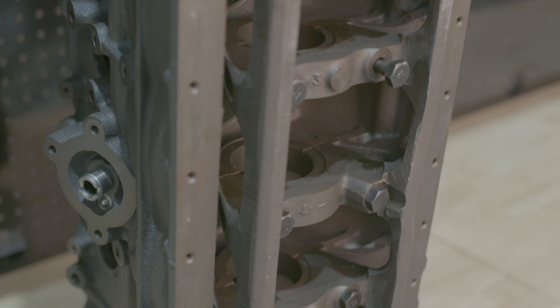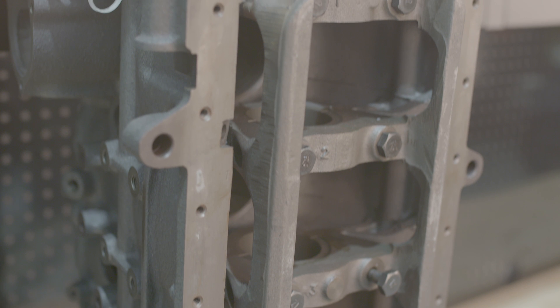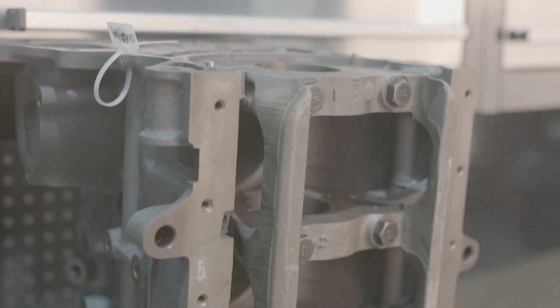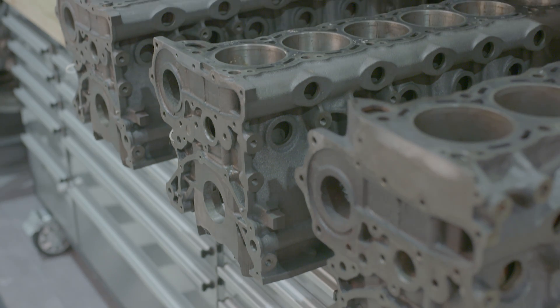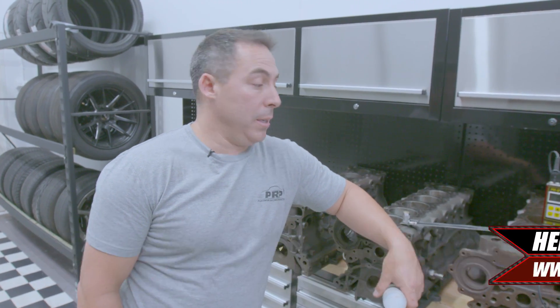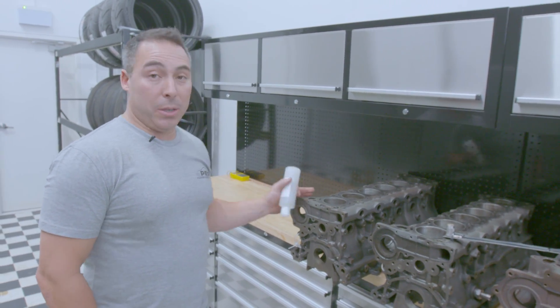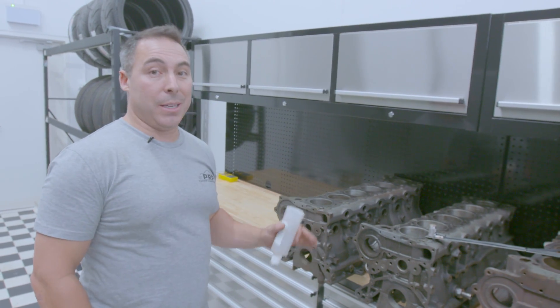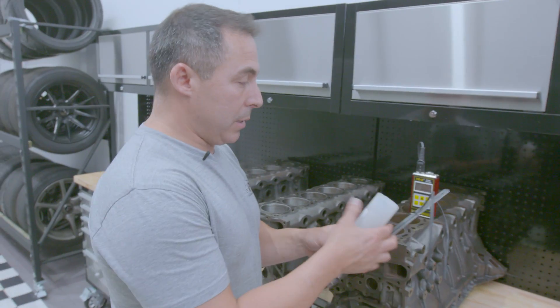It only has a slightly smaller stroke at 69.7mm, so the bore-to-stroke ratio suits high RPM — hence why they probably survive a lot of abuse in drift cars. With a smaller bore, one could potentially expect a thicker cylinder wall. Is the RB25 just a bored out RB20? Only the measurements will tell us. Now we're about ready to test our two-wheel drive RB variants, starting with the RB30.